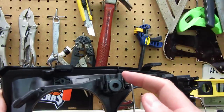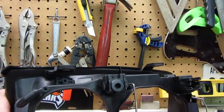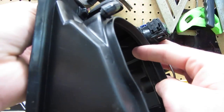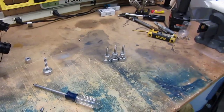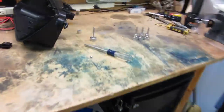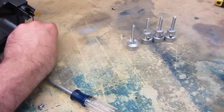Like I said, if you choose to glue this on, you're stuck with using these, and I don't know if I want to be stuck with those. What would probably be the best bet is to put the stock adjuster back in and screw it in all the way to its limits while it's off the car — that way you know not to touch it and you know it'll break if you screw it any more. So that's what I've been dealing with. I've got four of them and I've got to decide what to do. I've got all my parts and projectors that I haven't really started on, so hopefully I'll get this sorted out shortly and have an update. But that's what the billet adjusters are and that's why they don't work.